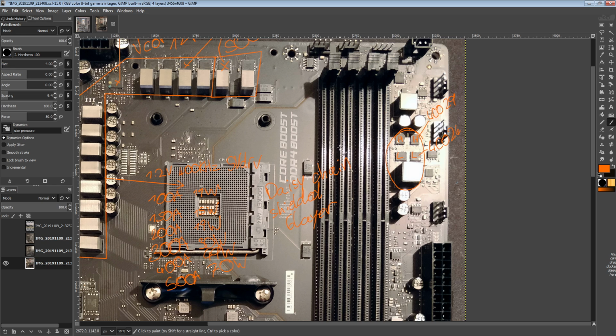But if you're running a 4-DIMM setup, you're not going to be chasing frequency records, because really high frequencies are completely pointless from a performance perspective. You get a latency penalty because your MCLK ends up desynchronized. Well, UCLK ends up desynchronized from FCLK, and so you get a latency penalty for data trying to get off the unified memory controller onto the Infinity Fabric. And that just completely tanks your performance.